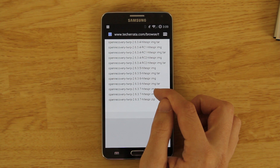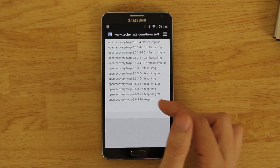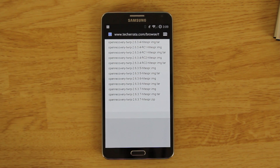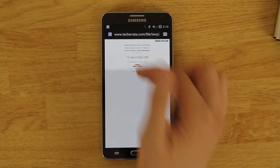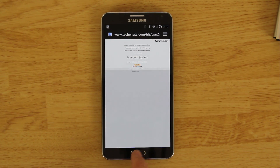The image file is what you want to download if you plan on using recovery tools available in the Play Store to flash the latest recovery. The image.tar is if you don't have root yet but want to flash custom recovery to your phone and then install the ROM. The zip contains everything, so just download it and wait for it to finish.